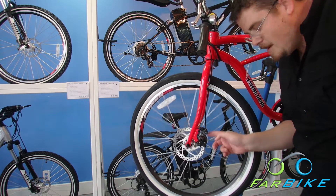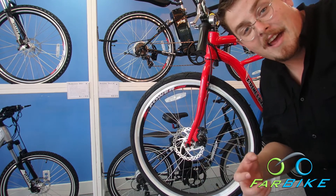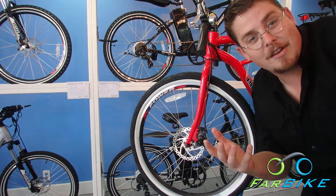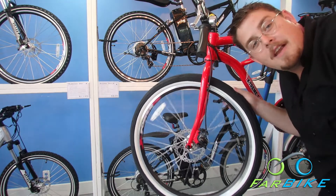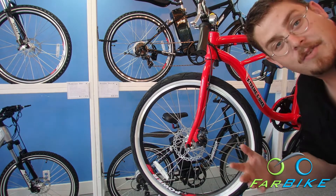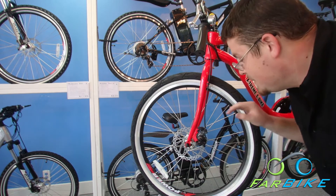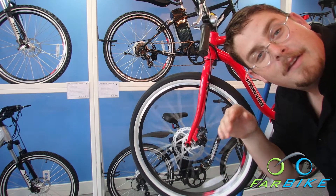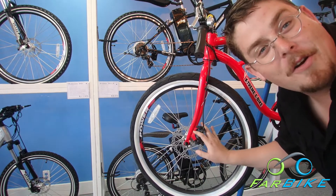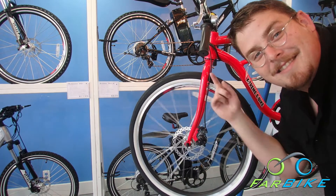Now that's on. Turn the wheel — it's rubbing a little bit, but we'll adjust that later once it's on the ground and fully assembled. If you want to know how to adjust your disc brakes, look it up on YouTube — there are lots of good videos. You don't want the brake pads rubbing on the rotor at all because it will lower your range and efficiency. Once you're done putting the bike together, adjust both the brakes and the rear derailleur so the bike runs as efficiently as possible. If you can't figure it out yourself, bike shops do this quickly for around $20 — might be worth it. But until then, let's finish putting the bike together.